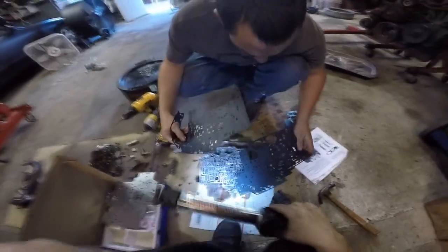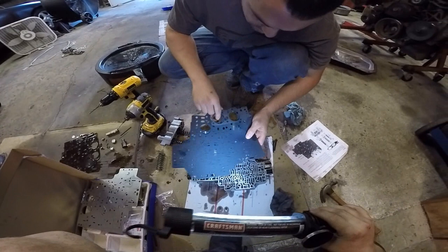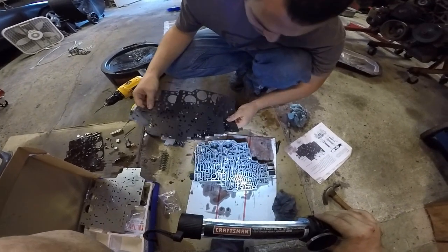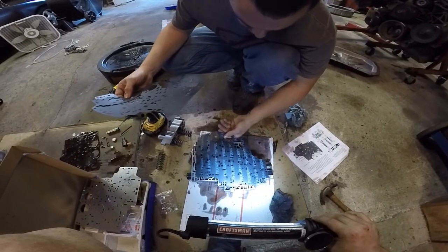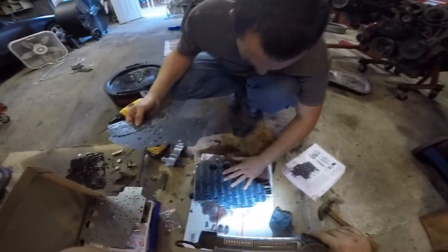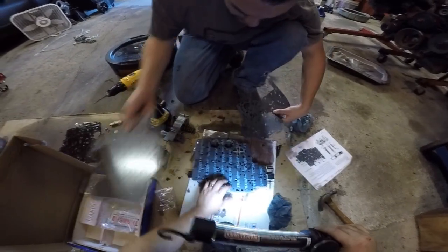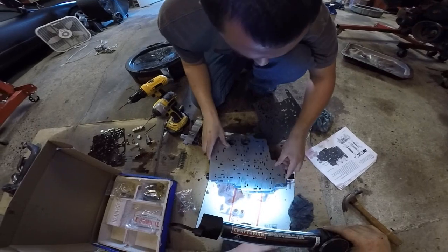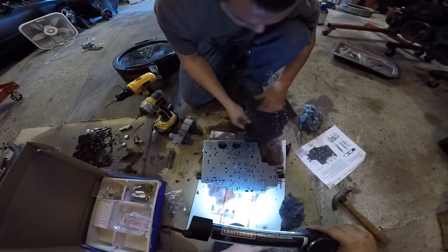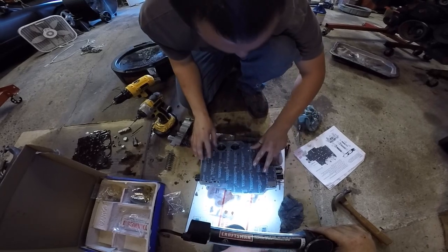Two gaskets. One of them's going to have a set of holes up here. One of them's not. Obviously, that's what this gasket's for. And I always get this backwards here. I believe this one goes on first. This edge. And then the plate. One time we took apart an ADE and it had the Transgo logos all over it already, so it must have been rebuilt at some point. And this one goes this way.